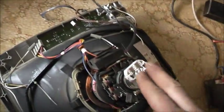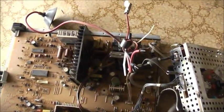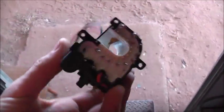I think I've got another flyback with both the leads still attached to it — we'll do that. Or I'll just use that one, which will probably be easier, because it's got all the leads already on there designed to fit through here. Most of the flybacks I've got have these cut off, so I might just get this one off and try this one. I'll modify it back with a new primary. What a challenge getting this off — these LG flybacks, monitor flybacks especially, are very hard to get off their circuit boards.